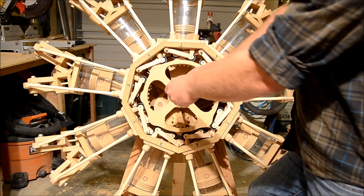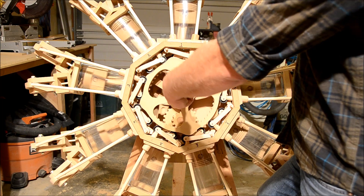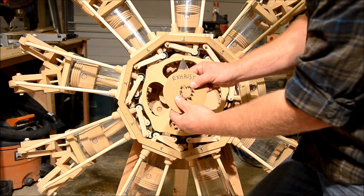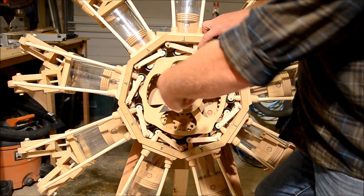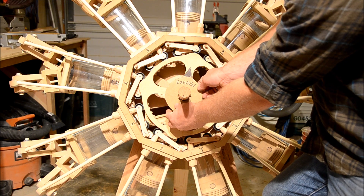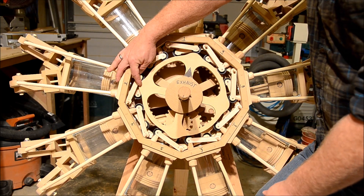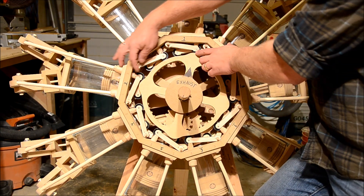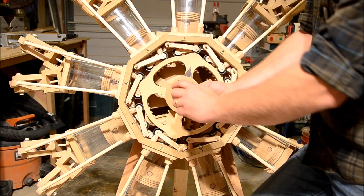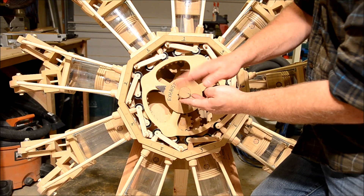For now we'll just look at the exhaust strokes because the intake rollers are buried but the exhaust rollers are right up front and easy to see. I'll reinstall our little cardboard cutout to indicate where we're at, and mark number one exhaust lifter at top dead center of its lobe with our exhaust cardboard indicator. So at 80 degrees of crankshaft rotation from here, we want number three exhaust lifter at top dead center. The lobes are 90 degrees apart, the lifters are 80 degrees apart, so we have 10 degrees to travel with the cam ring — and one-eighth of 80 degrees is exactly 10 degrees.